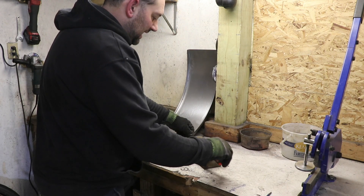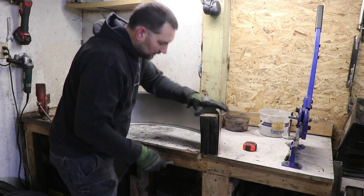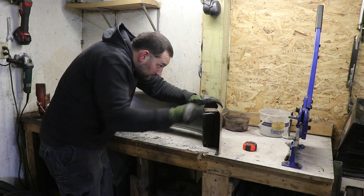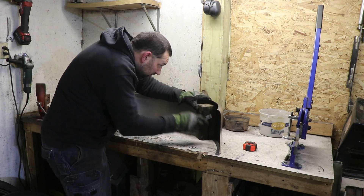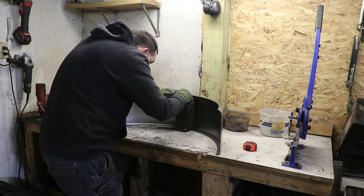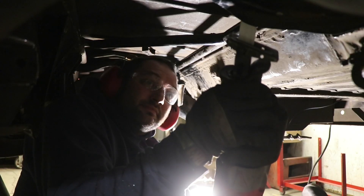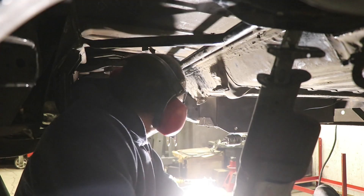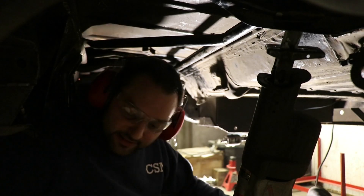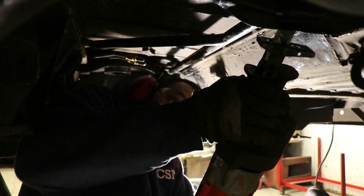I found a block of wood just shy of 8 inches, stuck it down, ran a scribe line across it - coming out within a sixteenth of 8 inches. I ran it and kept scribing as I moved it around, keeping it pushed against the flat edge, cutting the rounded lip off. I'll do the same with the other fender and then butt weld the two together. Not the funnest tool to be using for this, but it's getting the most cut out compared to any other tool - and man is it hell on the arms!